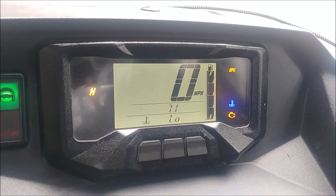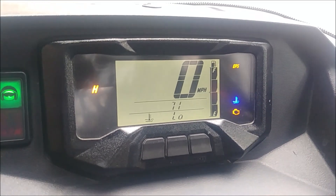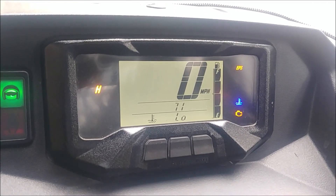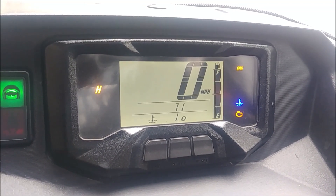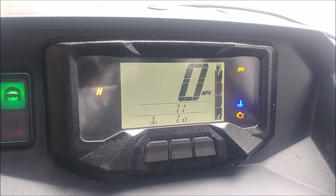I'm going to document this for anyone that might run into it. Code 71 — I looked that up and it's the heated wire that warms up the O2 sensor. Once I start this up and let it run for a while, you'll see this go away.